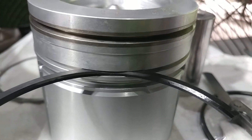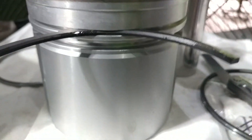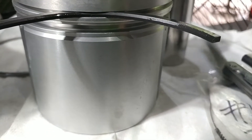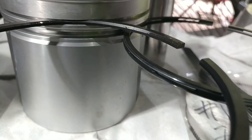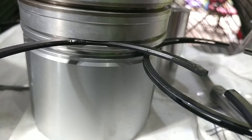The max on the middle ring is six thousandths, and we're definitely tighter — we're about three thousandths on this one. The max on the oil control ring is five thousandths, and both of these are tighter than five. I haven't seen any binding, so we're good to go on this set of rings.